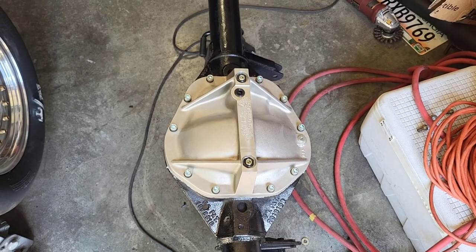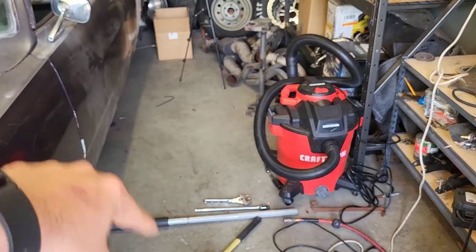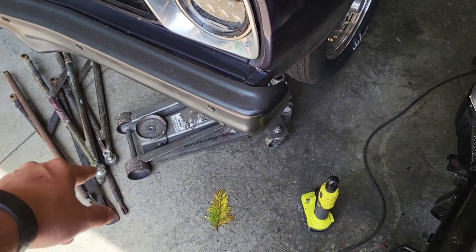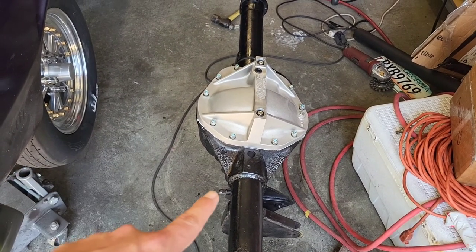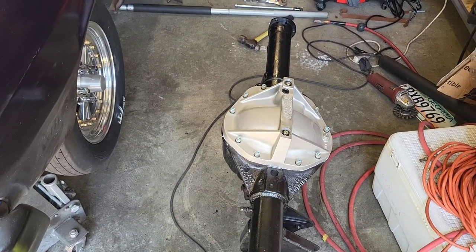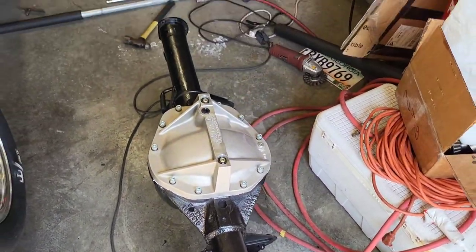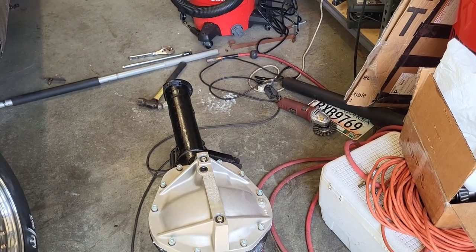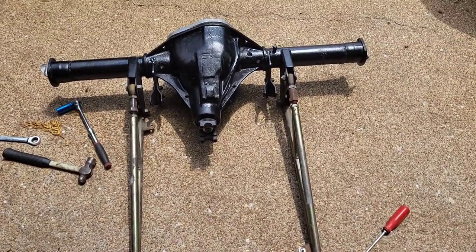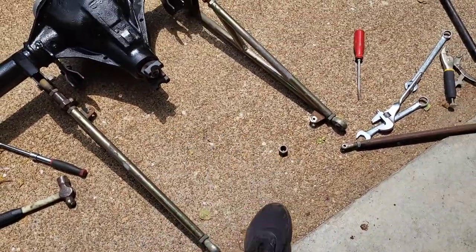Now the hard part — we've got to clear out all the exhaust off the car, and that's the brakes for this. We're going to assemble our new ladder bars, the gold ones right there, put them on the rear end, roll the rear end and ladder bars up in there, then hook up the ladder bars, jack it up, and hook up the coilovers. I'll try my best to film this. Now we got the ladder bars on the rear end, got the cover on it, so we can go ahead and throw it under the car.